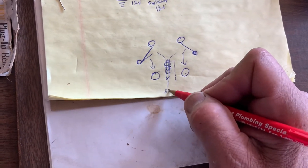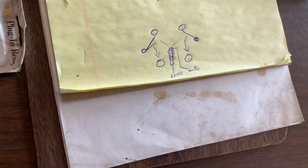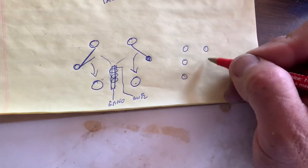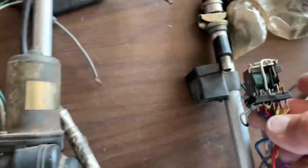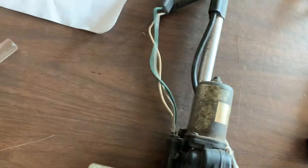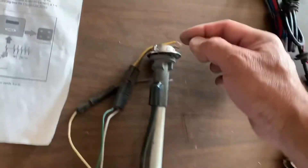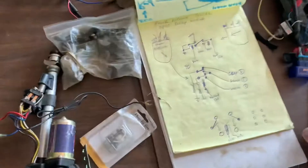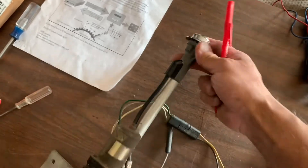There's a ground and a switched 12 volts. This is what your double pole double throw switch looks like when drawn out — and this is how the relay is hooked up. I pinned this out so I know exactly how it hooks up, because I've done this with my other antennas. Even in my Cuda I have a Saab antenna from the junkyard that already had a relay, with a little black mounting part that goes on the back of the fender. I mounted it in the rear, which makes the car look better.